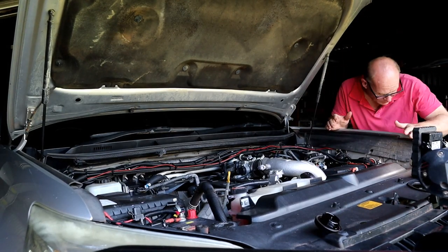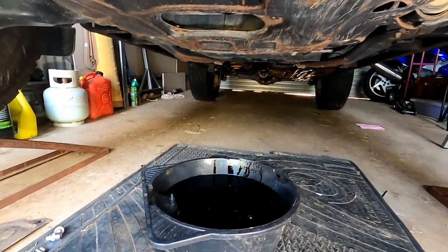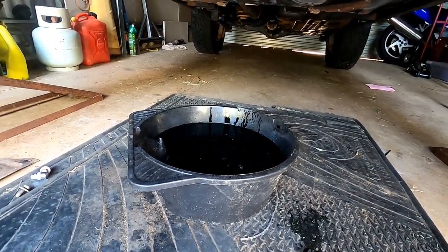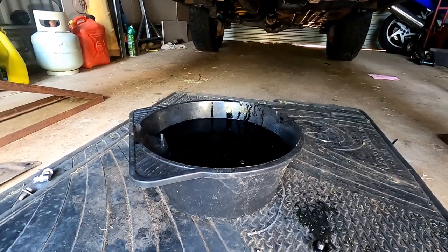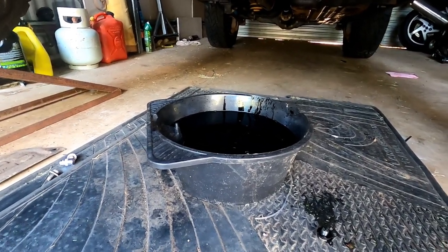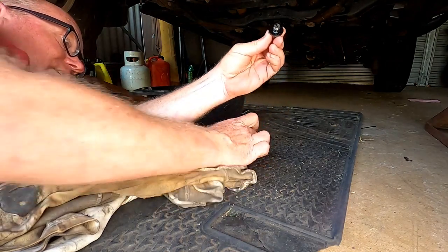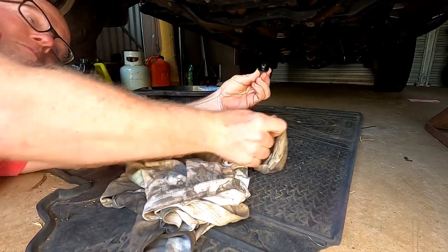Now we'll go down and have a look and see how that oil's going. She's looking pretty good — as you can see it doesn't fill that up in any way, so you're pretty much safe. There she is, just dripping down. One question you're probably asking me — where do I put the oil? The old oil goes back into that container. Seven litres, seven litres. Most tips have a place where you can tip the oil out and take your container back home again. On your nice concrete in your garage is a bit of mat, just in case you get an oil spill like I just did.